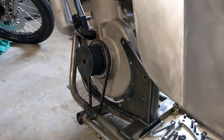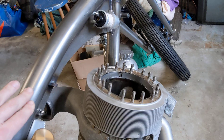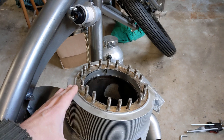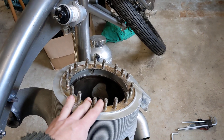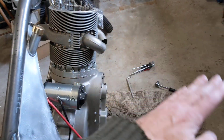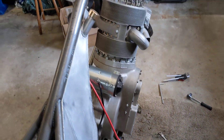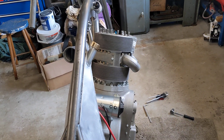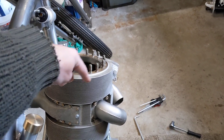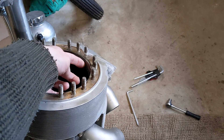The job of the day is all around the cylinder head. With the engine not bolted to the frame and canted over — it needs to be canted because since we put this gusset in we weren't able to fit the head with the engine in the frame — we had to swing it out a little bit. We didn't want it to fall out, because it's big and heavy; it could crack fins, bend header pipes, or crack some casing. It's not something you want to hold by hand while fitting the ring compressor and pushing the head down so the rings don't pop out before going inside the sleeve.